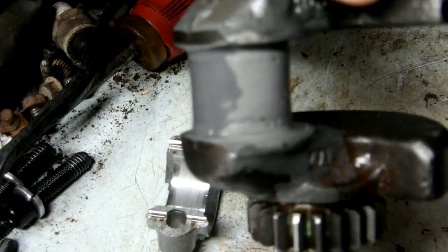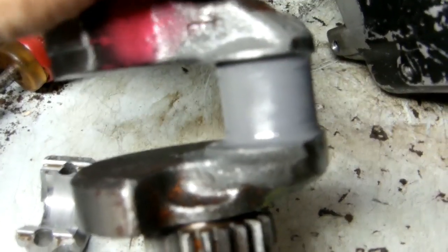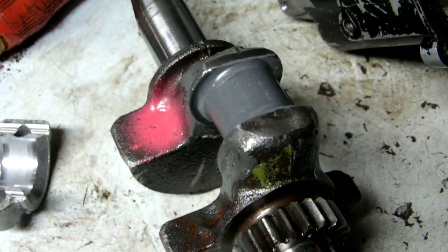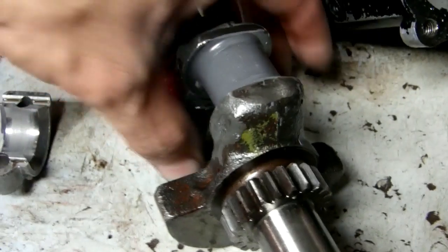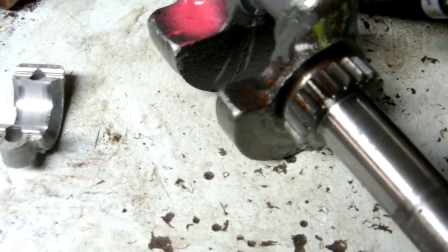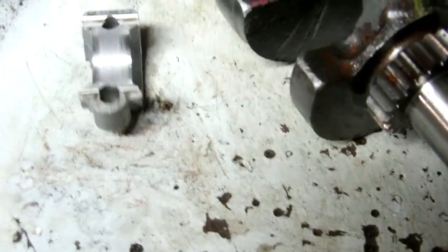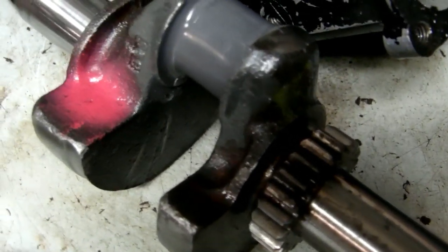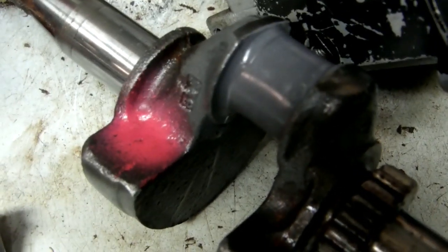So it survived the run, but not without any wear. Looks like it could hold up to the pressure for a while. I may try it in a lawn mower run — just put it back together. The problem is this is a Shorty crankshaft, so I'd have to find a deck that would work with it, as most of them are longer these days. Anyway, thanks for watching. Looks like the JB Weld connecting rod journal will hold up for a little while, but not forever. Everybody have a good one.